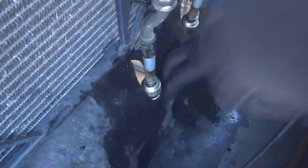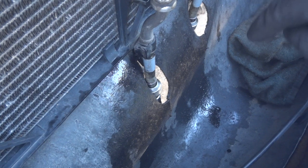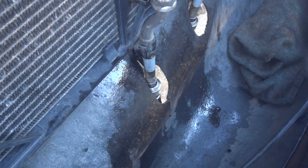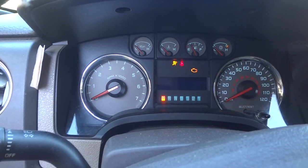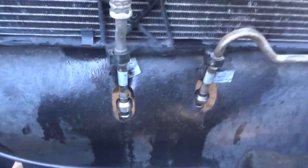This job, if you do it yourself — buy your own transmission line. The Ford dealer wanted $580. I think I got the transmission lines for about $150 — I'll put the price in the description. All right, let's start it up and see if we have any leaks. You might as well watch the success or the horror with me together. It usually starts right up pretty fast. Key in, run out real quick, look — I don't see anything leaking under the transmission. Up here's what I'm really wanting to see — nothing there.